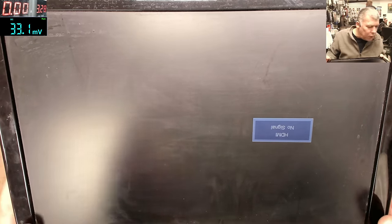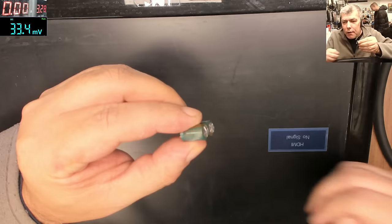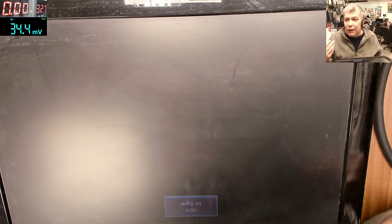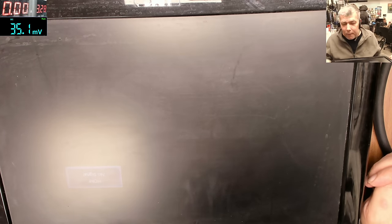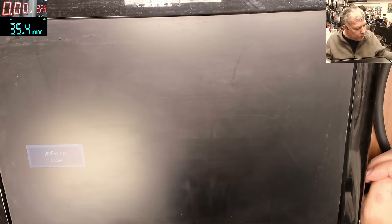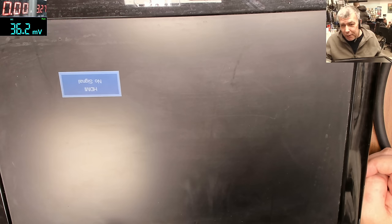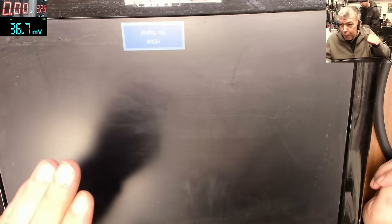That's what happens with old TVs. You have to think about the capacitor job. What the capacitor is doing is taking all the spikes from the switching. You have the rectifier bridge or rectifier diode, but the capacitor is absorbing all those spikes. After years, you'll see the capacitor gets a bump — probably because it's releasing gases from inside. So that's all for today. Thank you for watching. Don't forget to subscribe if you liked the video. And if you have a dead TV, it's worth checking if you have any bump on the capacitors. Bye.